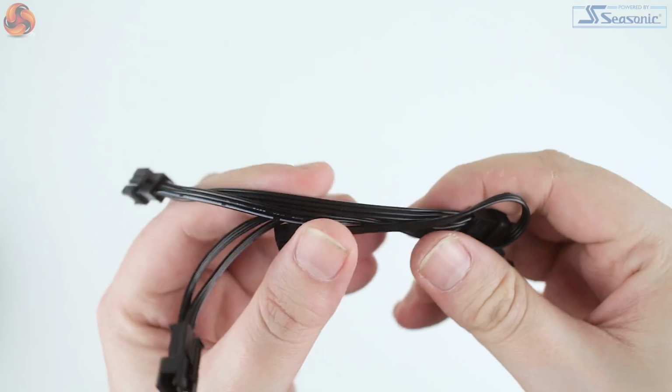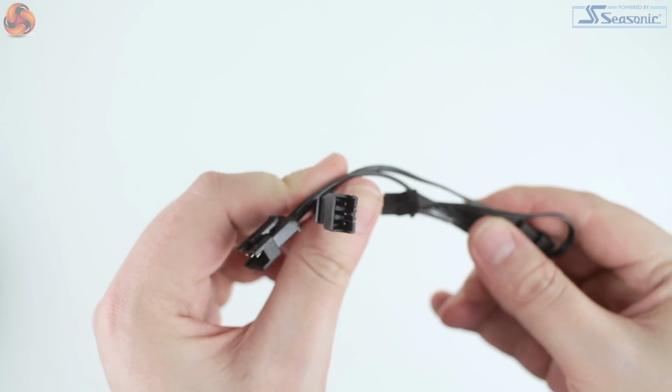As the FRYZEN cooler features a number of RGB LEDs, there are of course cables that need to be connected. On the cooler itself you have a standalone 3-pin cable for LEDs at the very top of the cooler, and a second for the LEDs for the fan. The fan is also a 4-pin PWM model, so you can also expect a cable for connecting to your CPU motherboard header. Included with the cooler are a number of extra cables for the inbuilt RGB lighting.